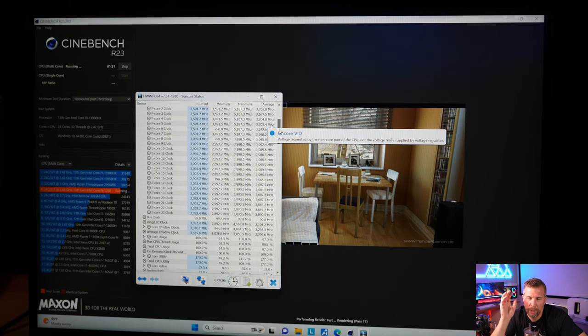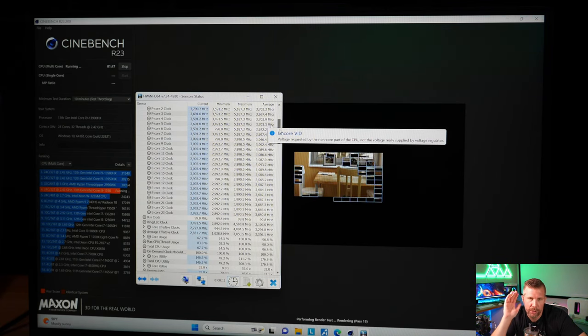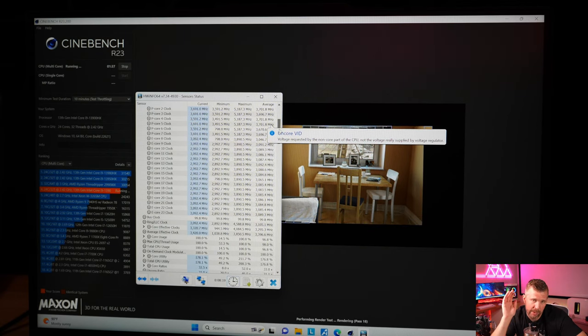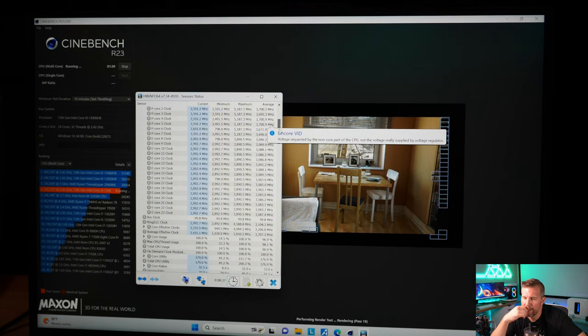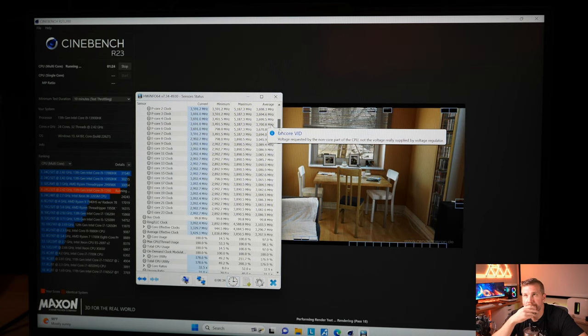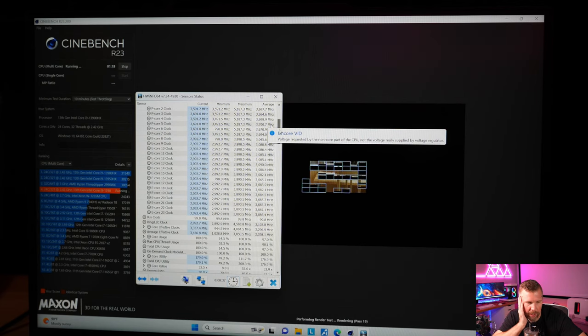The thing was, though, if you go to a medium performance profile with the Ryzen chip, it was really great at running. Instead of running at like 80, 90 watts or whatever, it was running at like 40 watts, and it was still putting out similar frame rates to what the Intel was doing in games. It was much more power efficient, but at the same time, it was still getting pretty spicy on the temps. So it's kind of a catch-22. I'd have to look at each game scenario specifically to really evaluate it.